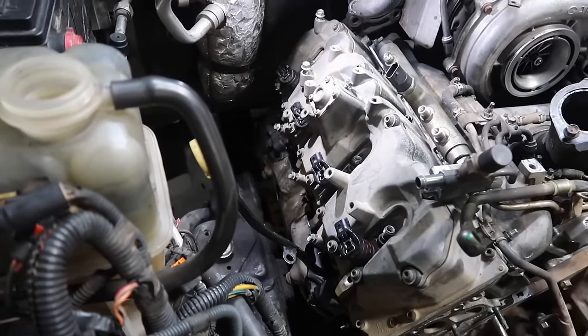you can use a flathead screwdriver. But essentially what you're gonna do is prime this fuel primer ball right here, and just keep priming until it gets super hard. Obviously, you're going to leave the bleeder screw loosened at that point. Once you start seeing fuel seeping out of that, keep pushing down until there's absolutely no air bubbles coming out of there. At that point, guys, go ahead and tighten it. Give it a few more pumps until it gets super hard, then cycle that key a few times, and then we'll fire up that motor.